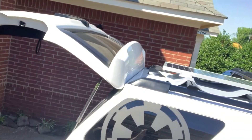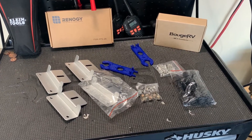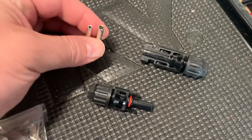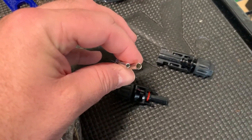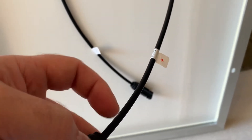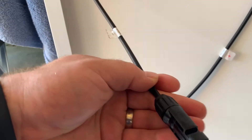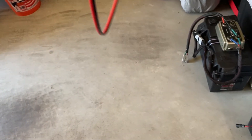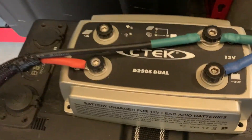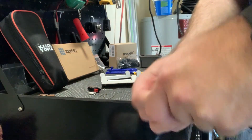Here's all the hardware, connectors, and brackets I'm going to use to set it up on the roof and get it connected. Here is an MC4 — both the male and female — and the inserts that are male and female. I need to determine which goes where. Looking at the panel, the positive has a male connector but the interior is a little bit smaller; the female is the opposite. I cut the wire to length so I can set it up on the controller with the right amount of slack to approximately match the Anderson connector I'm already using for the DC-DC charger.